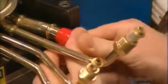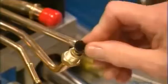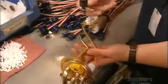They cap the tubing to keep dirt and debris out as a packaging precaution. Then they hook up some rubber tubing to the pump and secure it with metal clamps, linking it to the rest of the piping and hoses. They wire the fuel pump and hook up a connector to attach it to the engine's wiring. The sending unit is a float with a metal arm attached to an electronic sensor, which sends information about fuel levels to the fuel gauge on the car dashboard.